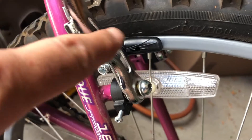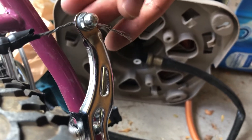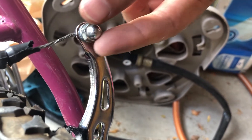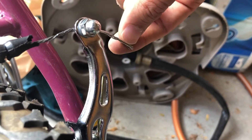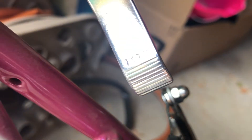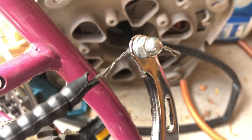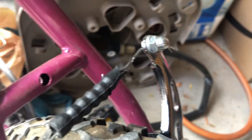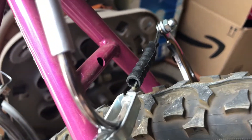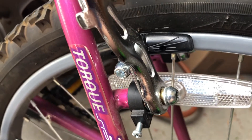I didn't have to take the whole thing apart on this side — I had to on the other side to clean and readjust the spring. My cables are also a little frayed; I might make another video on that. To push a frayed cable through the small hole, I recommend taking out just the piece with the cable hole and threading each individual element of the metal cable through carefully, so it doesn't fray further. I learned that the hard way — it really damages the cable long-term.